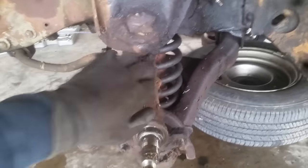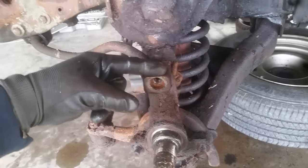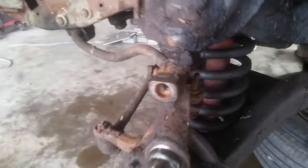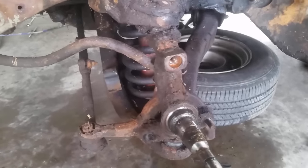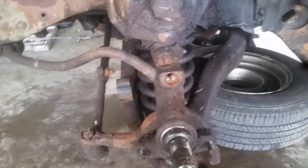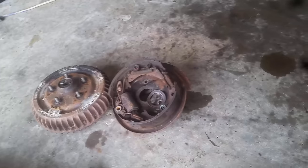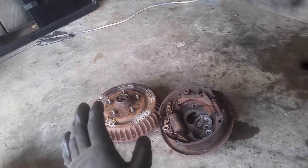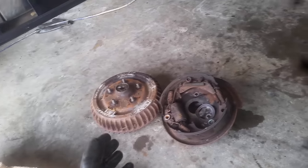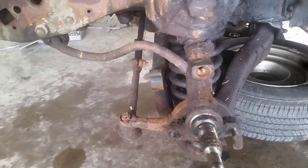What we'll be doing is, instead of buying spindles, we're going to be keeping the budget down. I'll be cutting off 0.610 of an inch off the top anchor bolt — that is the difference between this disc brake spindle and a drum brake spindle on a 66 GM A-body. And then I will also be sleeving the bracket, and I'll show you how to do that with the materials provided in the kit and a piece of the drum hardware, which quite honestly you'll never need again. The drum hubs are handy — keep those. But the drum backing plates and all that, that's all worthless. However, you could use a small piece of it to sleeve this if you've got a Buick, an Oldsmobile, or a Pontiac.